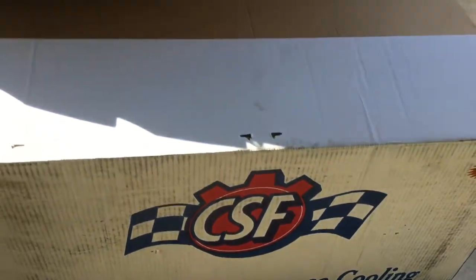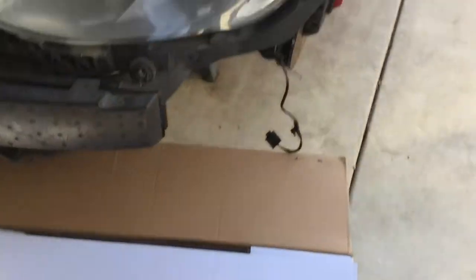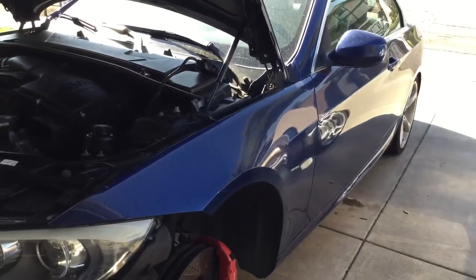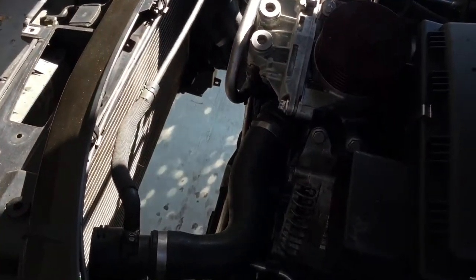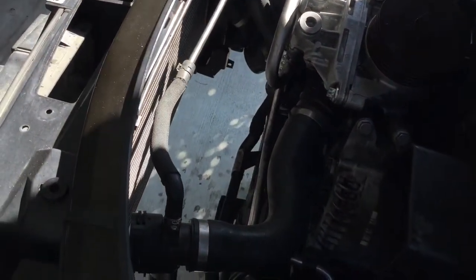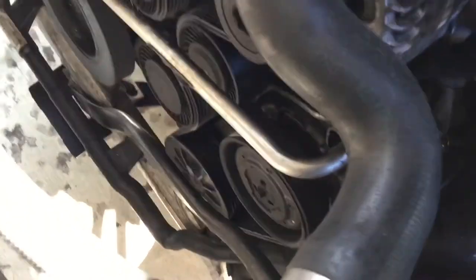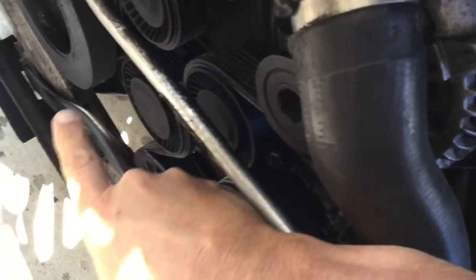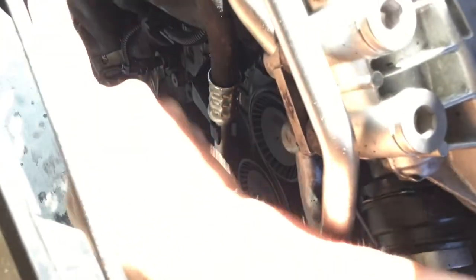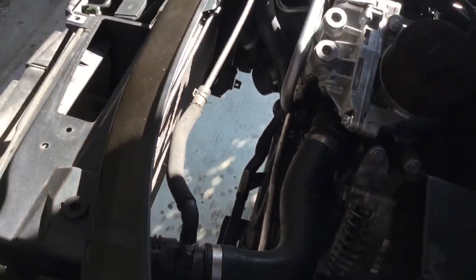This is my box opening for my 2012 BMW 335i convertible. You can go online and check out videos on how to pull the radiator — there are a ton of them — but if you're doing a convertible, those don't all work because there are a couple extra braces, like this cross brace right here. There's one that actually runs that way and it's got to come out. It doesn't come out the bottom; it comes out through the top.